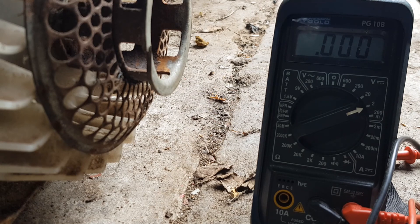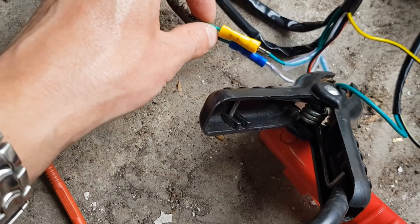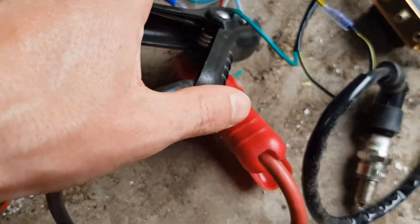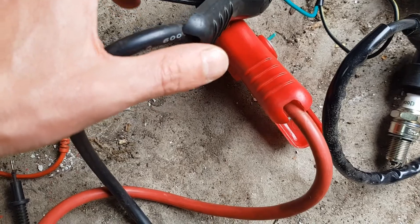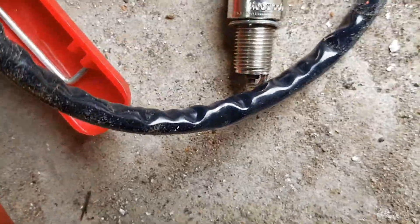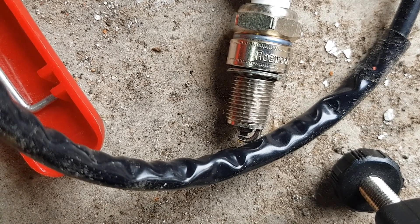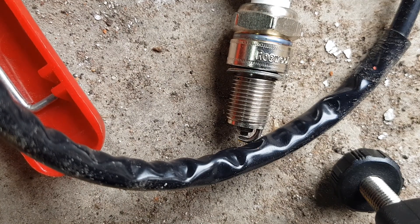I need to cut the plug off - green goes to earth, blue goes to the blue and white trigger wire. It's very bodged up at the moment. I've got the blue and yellow connectors picking up the earth and the trigger, my negative from the battery pack going to one of the earths, and the red going to the red and black. I'm looking at the spark plug - I turn it on and spin over the engine, and I can definitely hear it sparking. I think we have a spark.